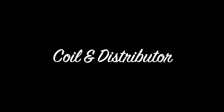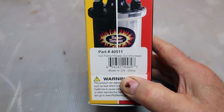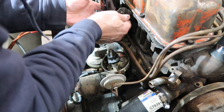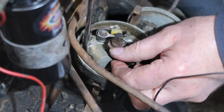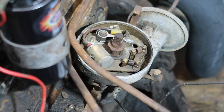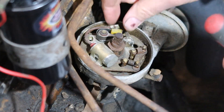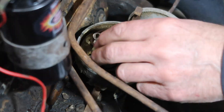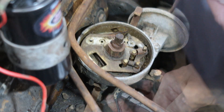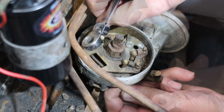To minimize the number of variables in the starting equation, we installed a new coil and electronic ignition system. We chose a Pertronix Flamethrower for the coil. We chose a Pertronix electronic ignition system made for the Ford 6-cylinder. The links to everything are in the video description. Following the igniter directions, we removed the points and condenser from the distributor. We also removed the distributor's external ground wire and its nuts and bolts. The hole that is left will be used by the wires from the igniter module.